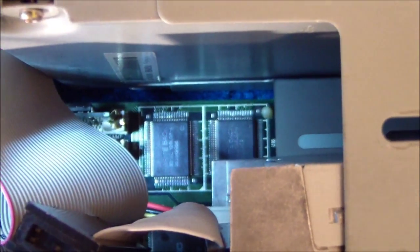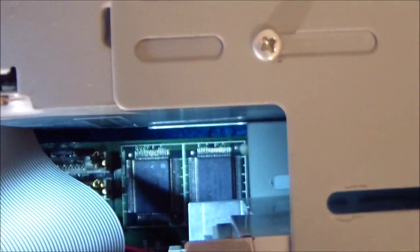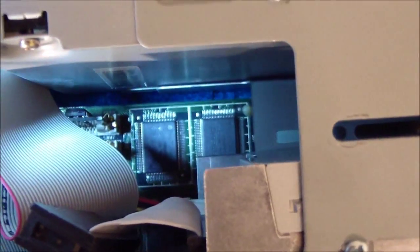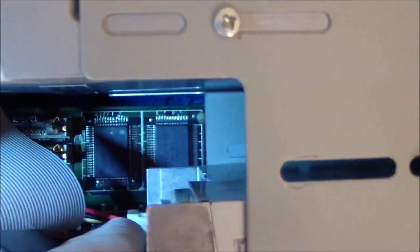If you look down there, let me see if I can get a close-up. Those are the fake L2 cache chips. They say right on them, and then there are numbers, like they're real cache chips. They are fake, as the Romulan ambassador from that Star Trek Deep Space Nine episode would say, it's a fake. Those are completely and utterly fake chips. I've seen revisions of this motherboard that lack those. They're not on there. I guess that was the less sleazy version being sold, but this one has completely fake L2 cache chips.